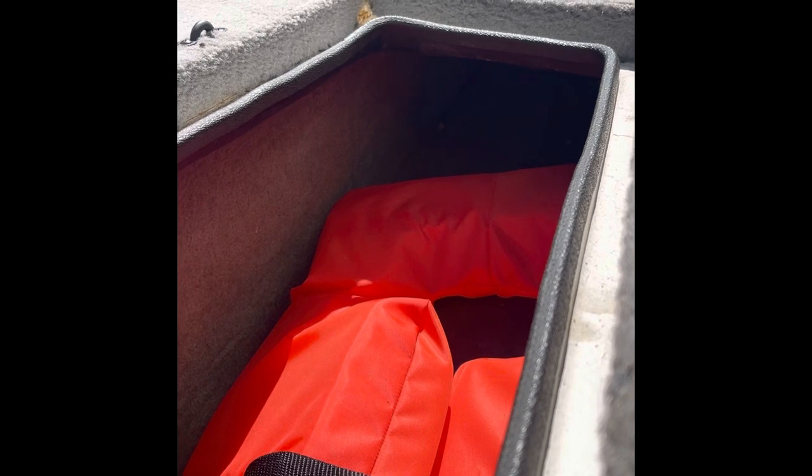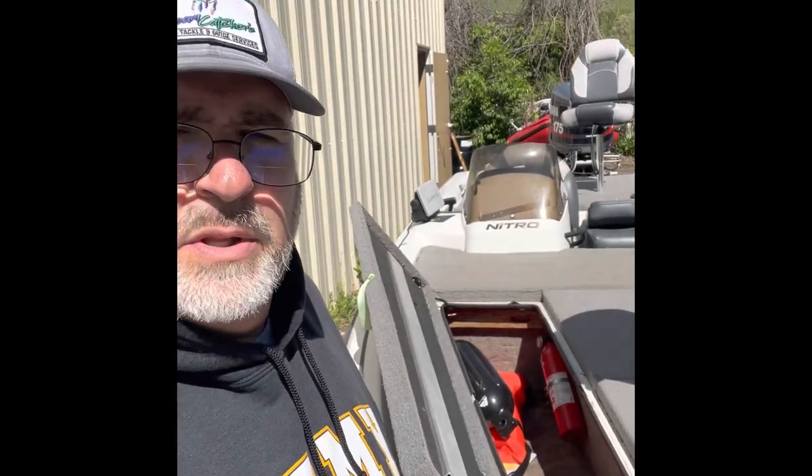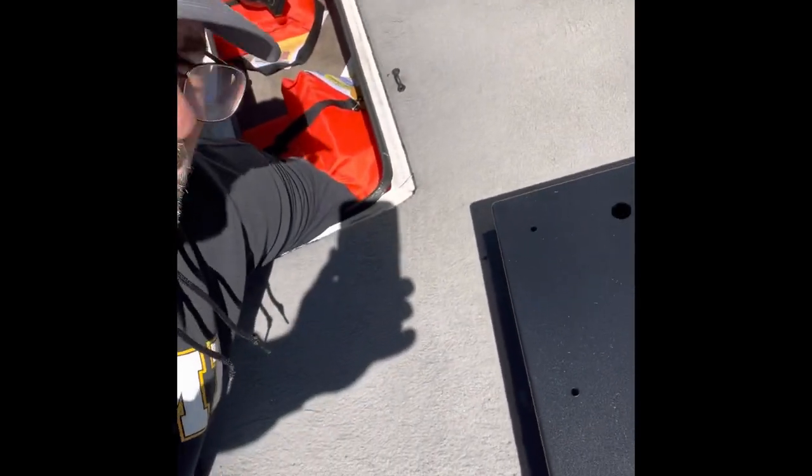I'm going to turn the phone around for you. As we can see from down inside of here, our structure travels all the way up inside there to make sure we're not going to have a big dip in that front deck, and this goes on both sides — structure on both sides of where the recessed pedal is going to go. We also want to reach up inside and make sure there's structure on the bottom, making sure we've got the thickness. A lot of these boats have a tendency to be way too thin. Here we've got about an inch and a quarter thickness in this deck, and as I reach all the way up inside this box, I can feel that thickness stays about the same all the way through.